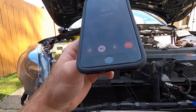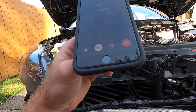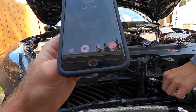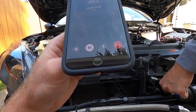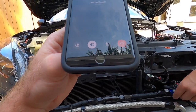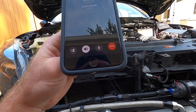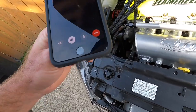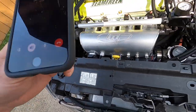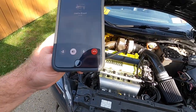Based on that, we can try turning the fuel pressure up a little bit - it'll just run a little richer. We currently have it set at around 43 PSI with the car off, so maybe bring it up to 45. Justin says that should help. I appreciate the tech tip - I didn't know that about the alternator. We'll check some things out, adjust the fuel pressure, do a log, and see how it looks.